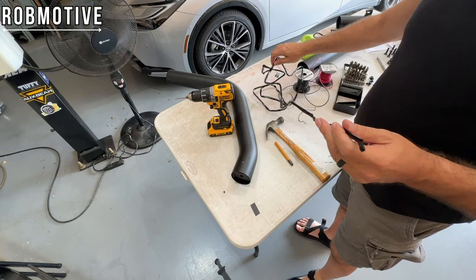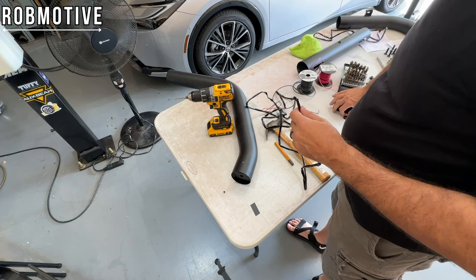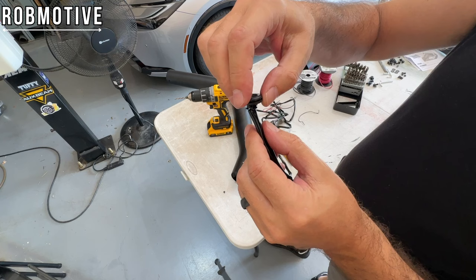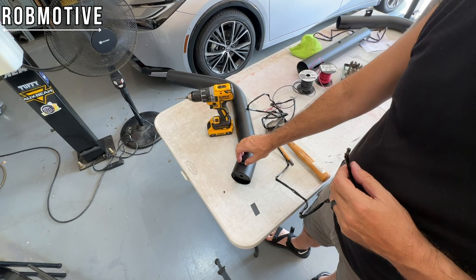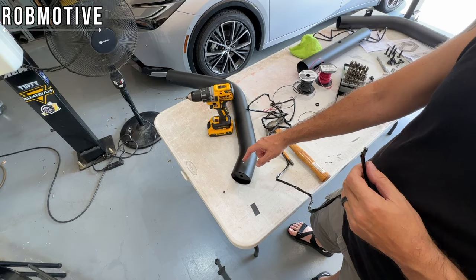So that means I needed a grommet, which I almost lost over here. I have a couple of these. And it fits through, and the other two wires will fit through as well. So I'm going to go ahead, drill the hole through here, put the grommet in, and then feed the wires through. And I will be coating this with a little bit of paint just to make sure there's no opportunity for rust once I drill that hole through the finished metal.